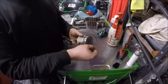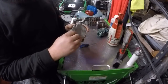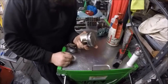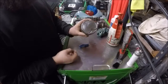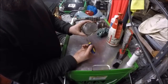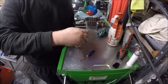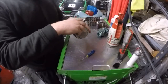Easy enough. Flip the piston over, put that one on there. Make sure it's sat in the land, run it round, drop it in. See? That went nice and easy. You can see I've had these off before because it shouldn't have that much gap — it should be sat in about there. But I'm going to take them off again because they're not the real ones, so they can disappear.